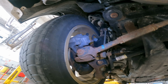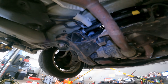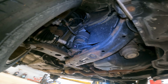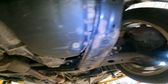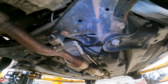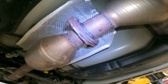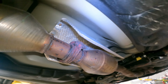Alright, so we're gonna recommend 4 tires, full alignment, rear brakes, pads and rotors, of course, and while we're there, we'll service the parking brake. And brake fluid looked a little green, so I'll look through the history, and if it's been done within the 2 years, I won't recommend it, but if it's been longer than 2 years, I'm gonna recommend a brake fluid exchange as well. And yeah, we're gonna let them know about this exhaust that's in crisis. It's not leaking yet, so I'm just gonna caution it. I'm not gonna try and sell them anything, but I'm gonna let them know that they're ugly.